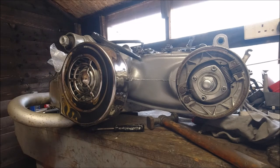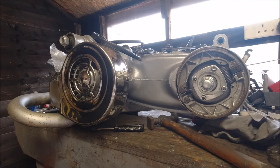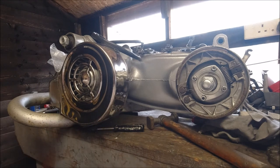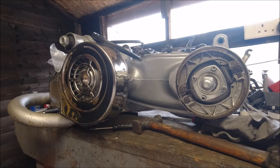I'm going to use a stand to run this engine outside a frame first. A tip from racing people years ago: jack up the back wheel, leave it running in gear so the engine's under load, on a fast tickover, stopping every hour or so to cool down — a way of quickly running in an engine. Where I live it's open countryside, and the average car driver doesn't realize you're riding something 50-60 years old that's just been rebuilt. Stay safe everybody, and I'll catch you on the next video — at least now my camera's working again. Cheers for now, stay safe, bye.